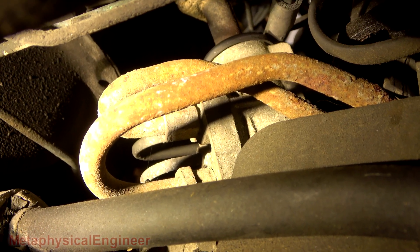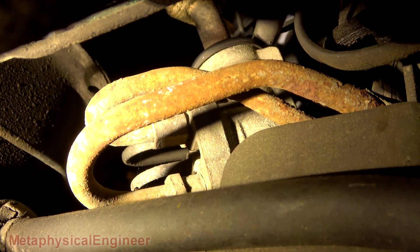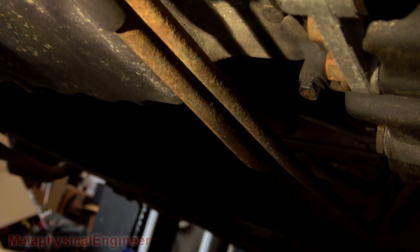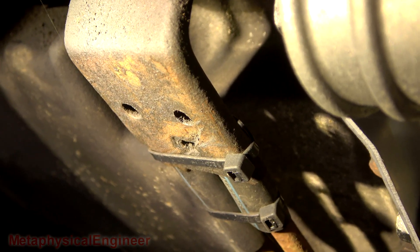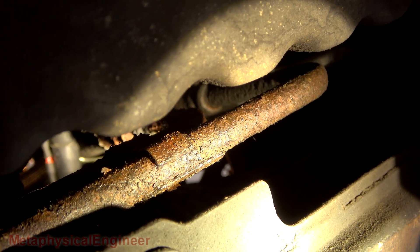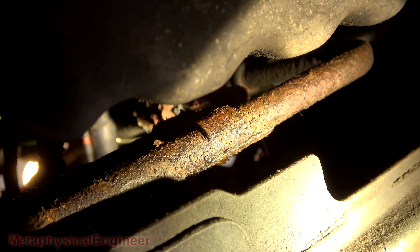The steering rack lives on top of the rearmost part of the front subframe. There's the supply and return lines. The lines hop over the subframe member, are held by a clamp there, then pass under the transmission and oil pan to another clamp which has been patched with zip ties and bits of hose as anti-chafing. From there they take a 90-degree turn towards the right side of the vehicle, go over a ways, then up the front of the engine to the pump. You can see the corrosion a little bit better from down here — that's why I want to swap these lines.